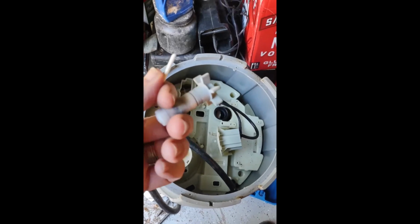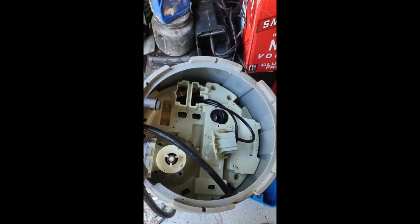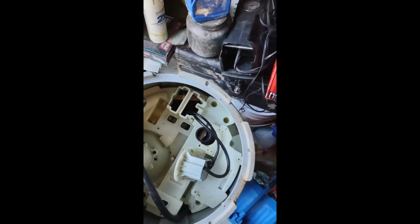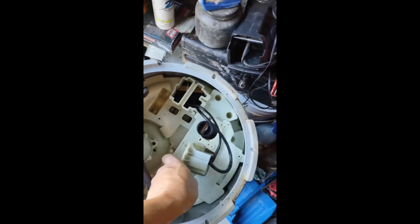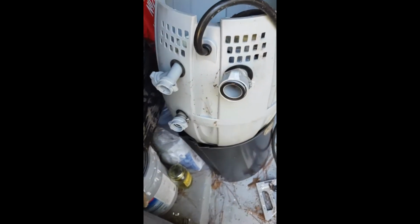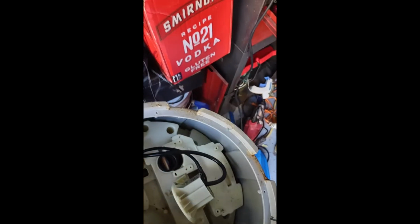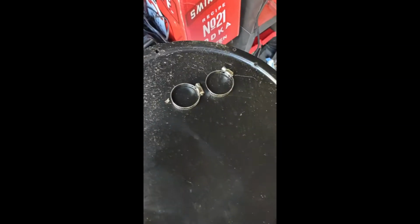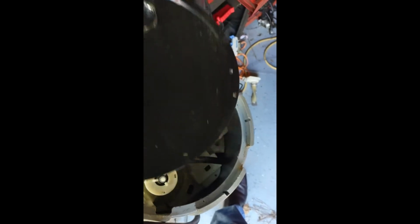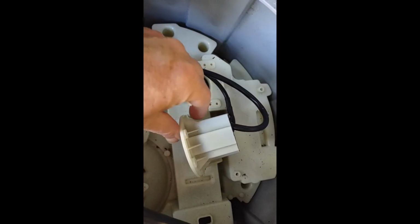As I mentioned in my other video, when your Saluspa Miami dies, it will be because the impeller went out on the impeller pump, which is at the bottom. You take the base, turn it upside down, right? Take the base off. It's only got 4 or 5 screws, and you just pull the base up, and there's the impeller sitting right there.